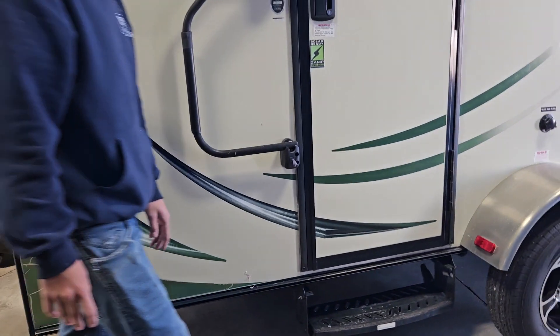Right here you do have your stereo — that's just like home. You've got your power button and speakers A, B, and C. C isn't actually hooked up to anything; it's just A and B. A is interior speakers and B is exterior speakers. On the other side of that wall you have your TV. Up from that you have your coax cables, which hook up to your stereo, and your cable satellite inlet with the satellite button on the right. Turning on that red light activates the satellite on the roof, which will also give you better radio frequency.